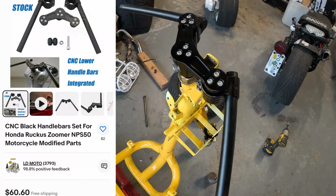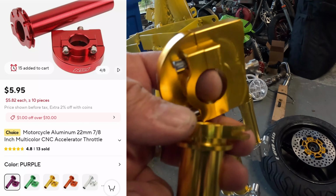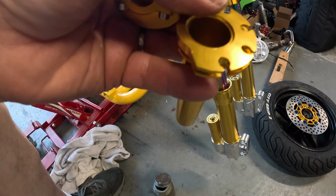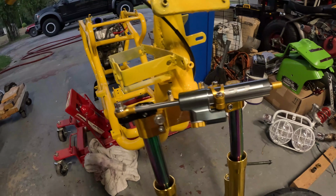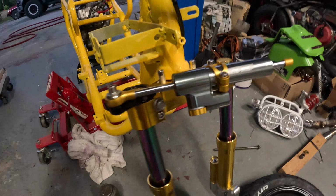Sport bike style handlebars, clip-on style, offer a lot of range of adjustment. This NCY throttle tube's kind of neat. You can use it for left or right. It has a lot of positions on it, so if you have too much cable slack or too little, you can make up for it with that. I thought it was kind of a gimmick, but that thing definitely works. You can loosen it up some, and when it's tight, it really dampens it. Looks cool though. It's like something a race bike would have.